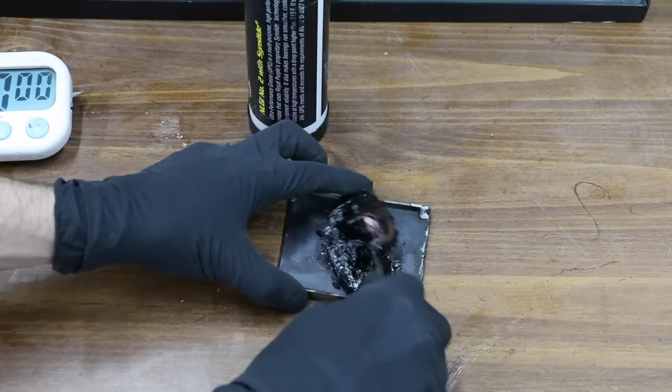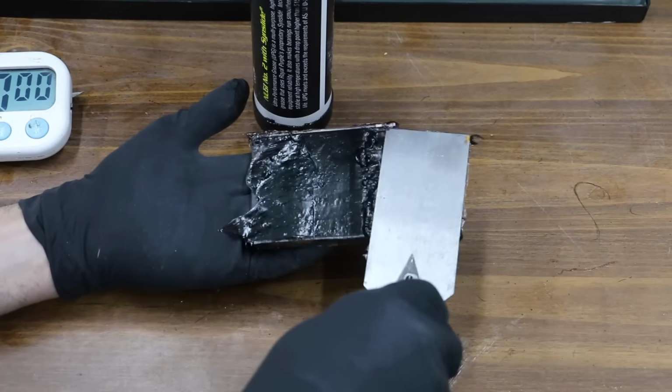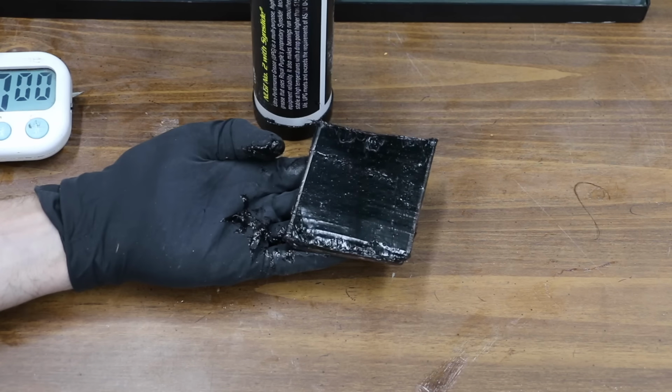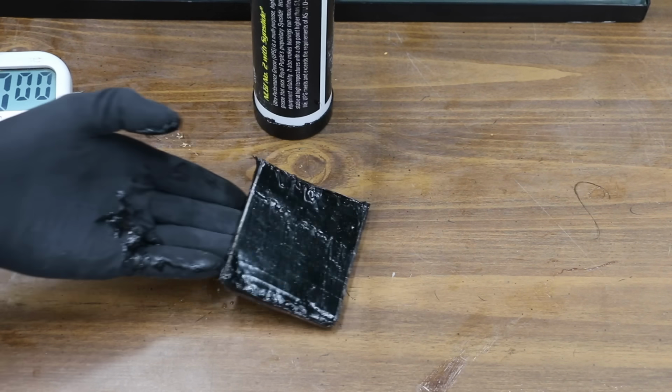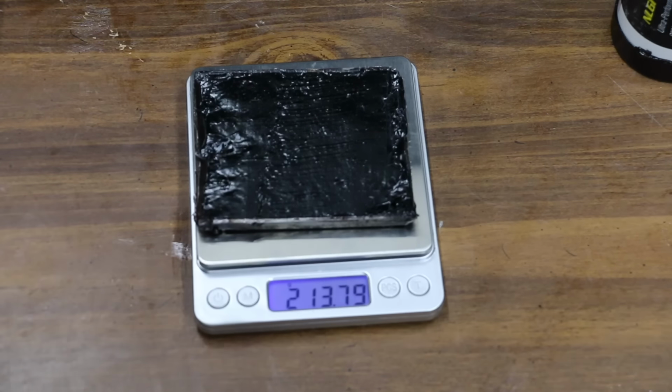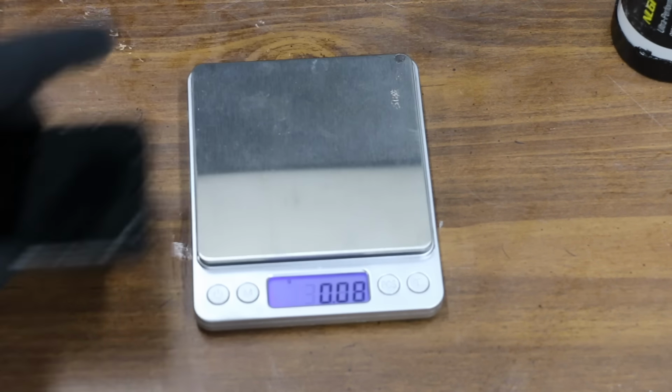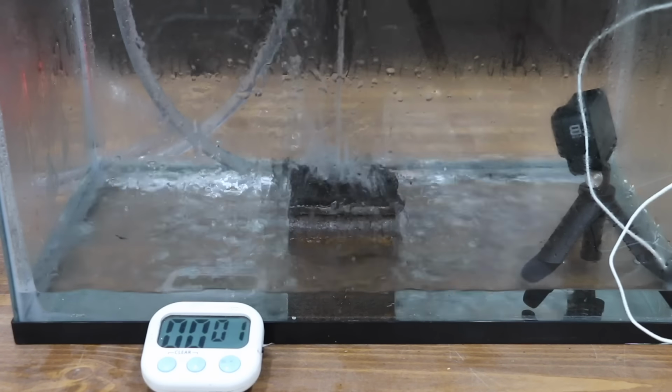The water spray-off test will let us know how well these greases withstand exposure to water. We'll test one grease at a time. I'll first apply a 1/4 inch layer of grease to the test plate, then weigh the test plate. The water in the test will be right at 100 degrees Fahrenheit. Once the test plate is in position, the test will begin when the water jet sprays water onto the test plate. The test will last right at 1 minute.